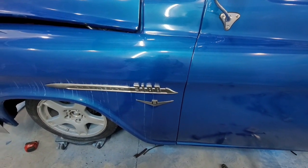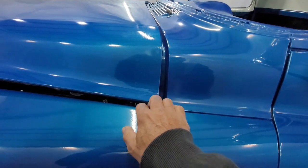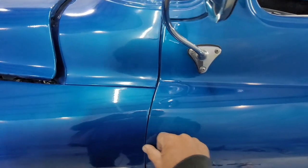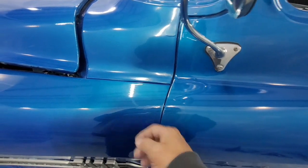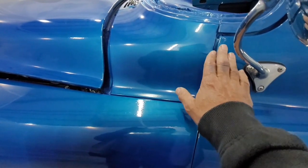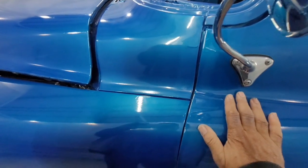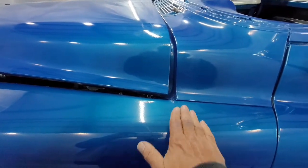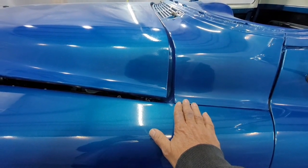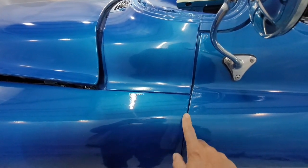What I do next is make sure this height is right. The bolt here, you can put shims in and raise this up and down. I also make sure that these two are fairly where they need to be, and that's the orientation of going in and out here with the door. But if you already got the door flush with this, you know it's right, you want to get this lined up with your door. So, the little bolt here, allow the fender to move in and out, plus shimming it up and down, you can get this line right, and you can get this right here right.